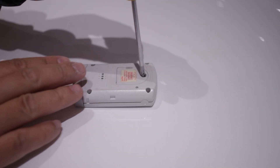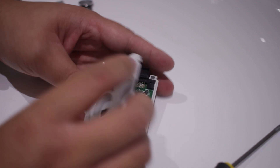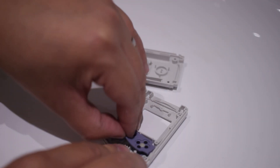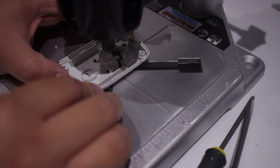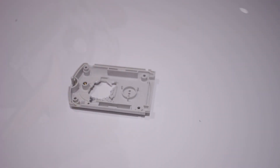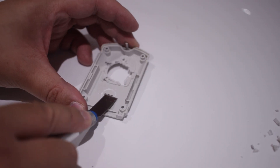First of all, we need to remove all the components from the VMU. There are five screws, including a battery bay on the outside, and two screws on the inside. Remove the speaker and buttons, and we now need to trim the inside of the board. I first used a Dremel, but it actually made things a lot more difficult for me. It may be because I had the wrong drill bit, but I ended up using a pair of flush cutters to finish the job. Using a small chisel knife to remove the plastic and neaten the case made a massive difference.